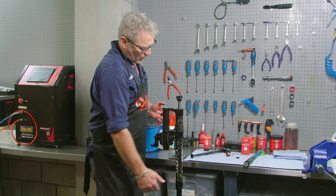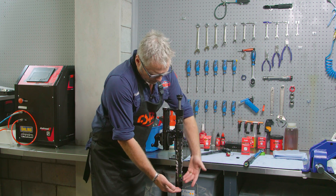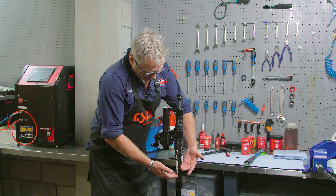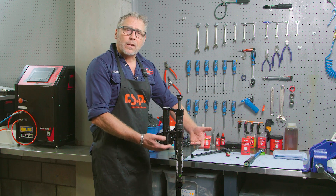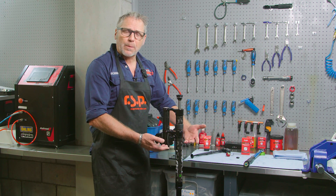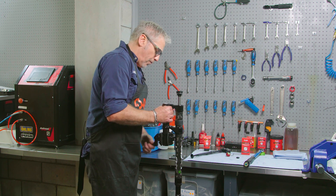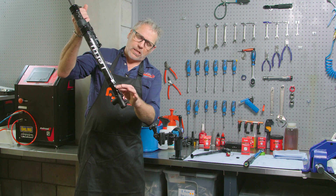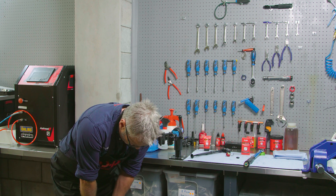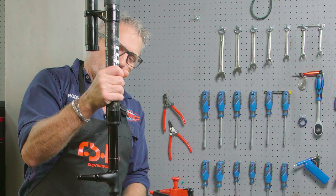Now we can push the fork up, but if you look, you'll see the fork is only getting a limited amount of travel. This is because the bearings have actually set themselves into the travel and it's limiting now. It almost feels like the fork is topping out or bottoming out. A lot of people say the fork is leaking air, but actually what's happening is the fork needs the bearings reset. So to do that, on or off the bike, just let all the air out. You can see where the fork is stopping — just take some force, push it on, and you can see now I've reset the bearings so the fork will get its full travel again.